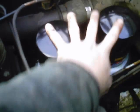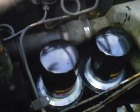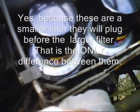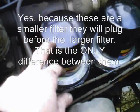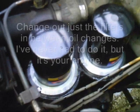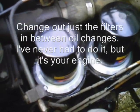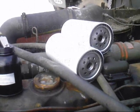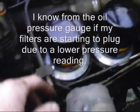$10 give or take right now for both these filters. Spin them off, change them, put new ones on — don't even change the oil in the engine, just do the filters. These incidentally have the anti-drain back valve, so when you start this engine you have almost instantaneous oil pressure. The 1794s, however, do not have an anti-drain back valve, though you still get oil pressure a heck of a lot faster than with a canister filter.